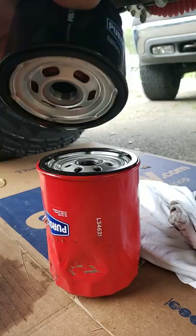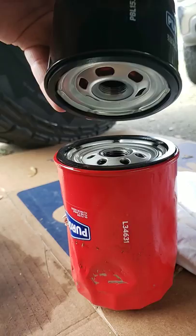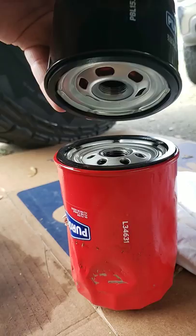PBL15313 — they all told me that's what you need for a 1990 K5 Blazer if they can find that in their computer. But I said I need that at half the length so it'll clear my headers. It's the same diameter, same gasket and threading, just shorter.